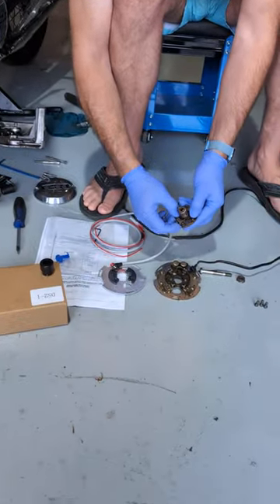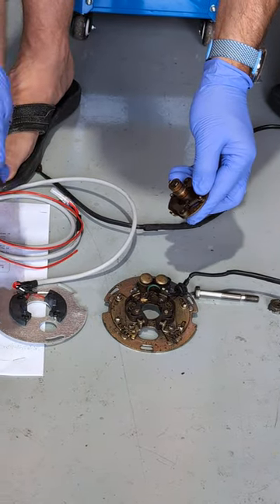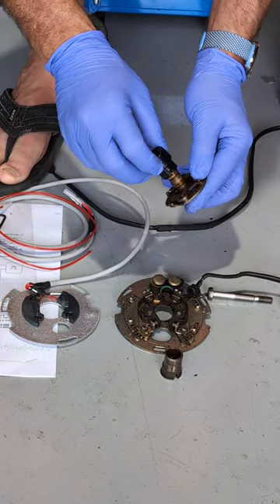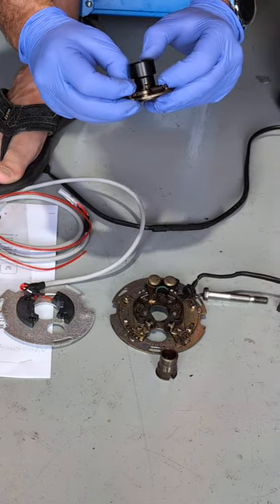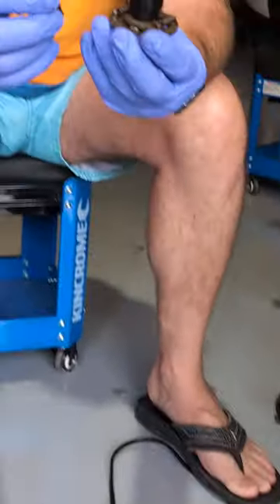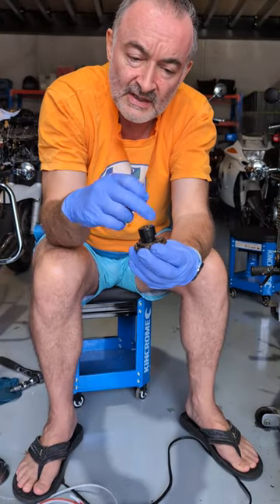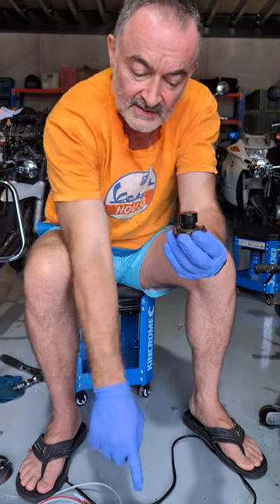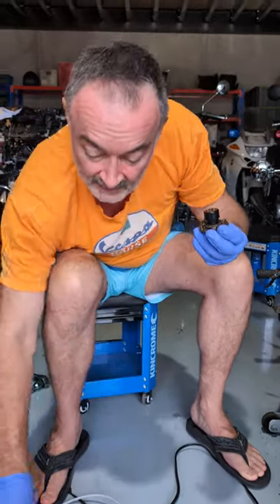This sleeve is the factory sleeve. You then use the Danatech sleeve and line that up with the cam lobes — which is a little fiddly — like that. So you've replaced OE with Danatech. That is now going to be the only thing that's spinning. Literally a single point of failure, but when you consider the multiple points of failure in the original system, it's a much, much improved system.